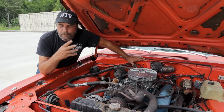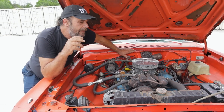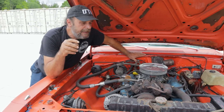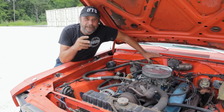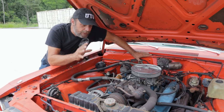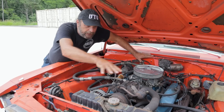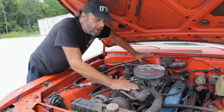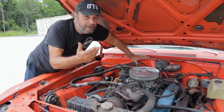The system is filled with a refrigerant — usually Freon — and there are different types: the R12 that these cars were born with, R134, and various hybrid things. But the idea behind any refrigerant is that it has very small molecules that move very fast, and the change from being compressed to being freed is what allows that temperature drop you feel inside the car. The refrigerant is in a closed system.